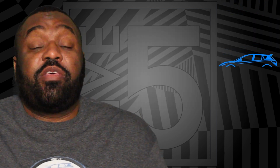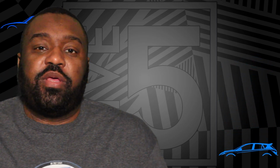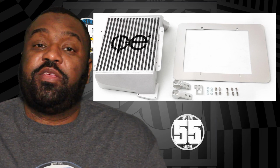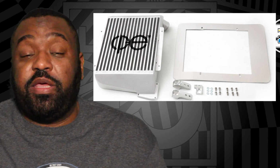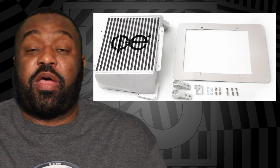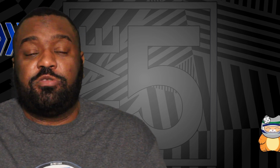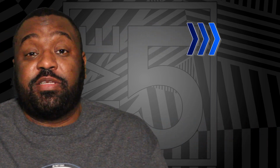So like I said, there are ways to make power with a top mount intercooler. I know the CPE unit is a drop in, it's just a remove and replace, so everything lines up. You don't have to get any new hoses, you don't have to get any tubing, you're not going to have issues with space requirements. I know that the shroud that goes over the intercooler on the stock one you won't be able to use, but that's a given. Nutshell, yes, you can make power with a top mount intercooler.